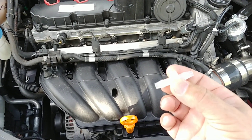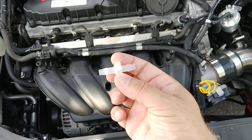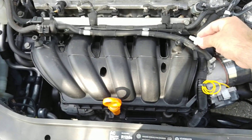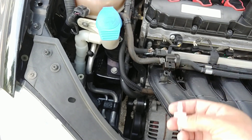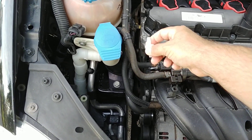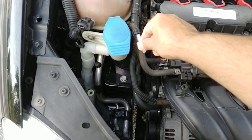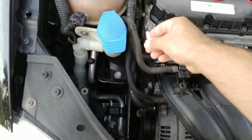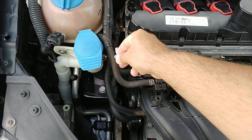So what you do is install a little check valve, just like this one, in the line. Some people have actually installed them over here. I was suggested by a shop owner — Josh Pash told me to just put it over here between the purge valve and the firewall. So that's what I'm going to do.